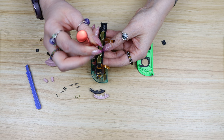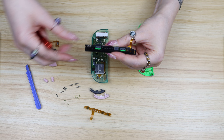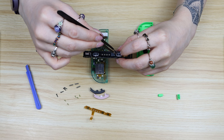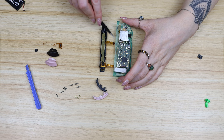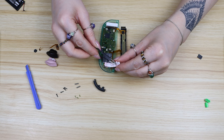The railing does actually have two colored buttons that match the Joy-Con case so if you want to replace those as well then just take your Phillips head screwdriver and remove the two gold screws to expose the buttons. Once you've exposed them you can take them out and put your new ones back in, but don't forget to put these little rubber parts into your new buttons before you insert them back into the railing. Once you have your desired buttons in place you can screw the main component back into the railing. When you do this just make sure you're putting it in the right way — both of the ribbon cables need to be pointing in the same direction. Then you can plug them back into the motherboard and move on to putting the left trigger button back in.